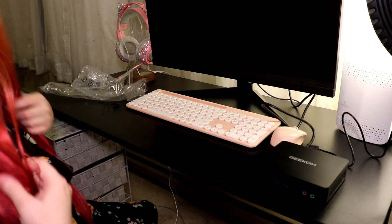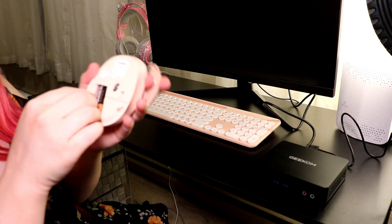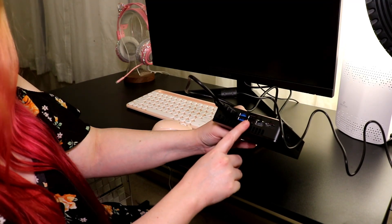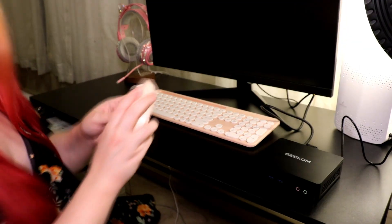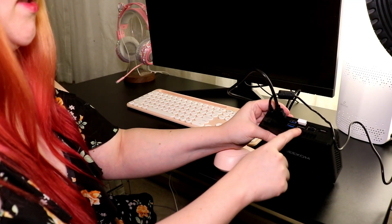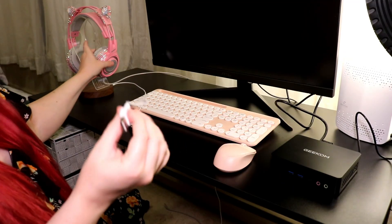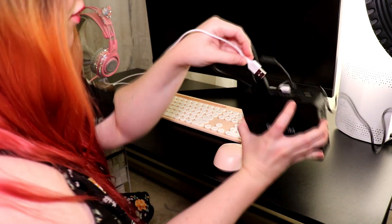So now our PC is ready to be turned on, but we still have some connections to make. I have a wireless mouse and keyboard that has a USB, so I'm just going to take my USB — it works for both of them — and put it in the USB 2.0 ports, which are the ones that are black and not blue. Then I'm going to go ahead and turn my wireless mouse and keyboard on. If you have a wired mouse and keyboard, I'd highly suggest putting them in the USB 2.0 slots, because all the other ports are better for things that require high data transfer speeds, and our mouse and keyboard just don't necessarily need that. I also have a light-up stand for my headset, so I'm going to put that in the USB 2.0 on the back as well.